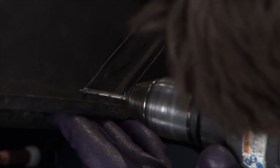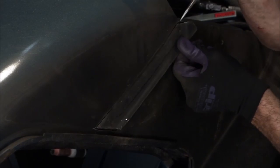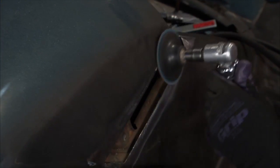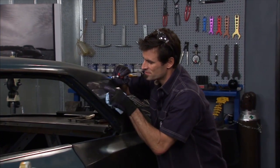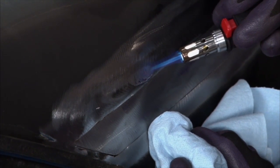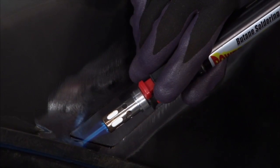I'm popping little eighth-inch holes in the corners — that makes it easier to cut straight lines with a cutoff wheel and have a nice little radius on the edge. I saw some factory lead coming through here when I cut this out. I want to show you how to remove it: heat it, it turns liquid, comes out of nowhere. If you're looking for it, you'll find it. You heat it up, it turns to liquid, wipe it off. Found a couple little spots down in here where there was some old lead — want to make sure we get that out of the way.